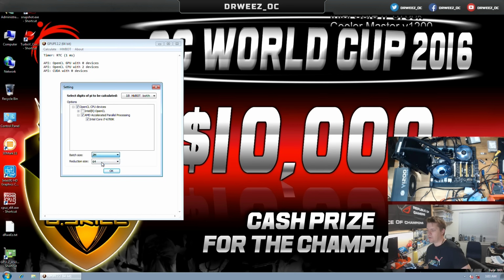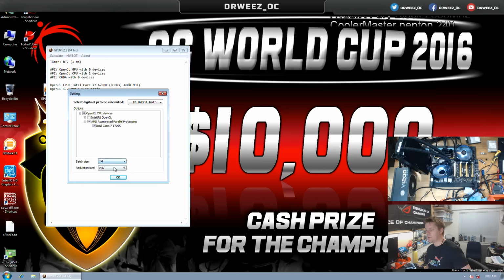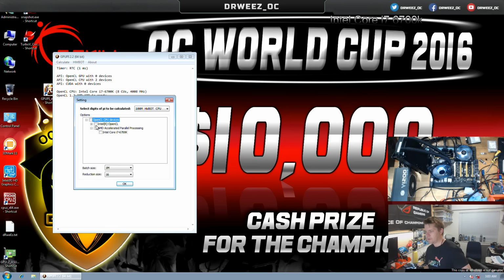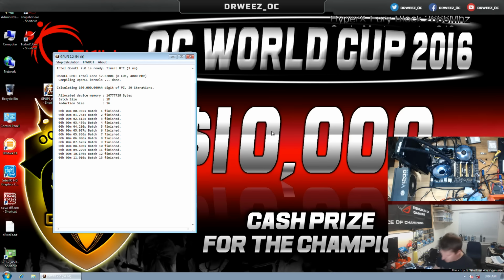So we'll go ahead and select the AMD acceleration, and we say, right, we want to use 2 million batch sizes, and we want to reduce it by 256 each loop. Okay, and then that will go and, well, crash first of all. But these different options here will basically determine the calculations and the steps and all that, and it can have an effect on performance. If I'm not even running that, then I'm either not stable or I need to restart. Yeah, I need to restart for those runtimes. So this is the trick with GPUPi, for your setup, is to find the right little sweet spot.